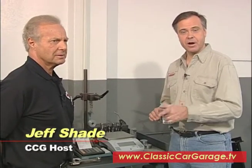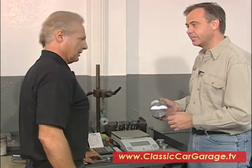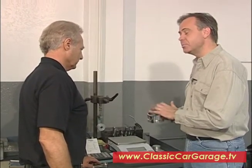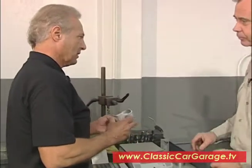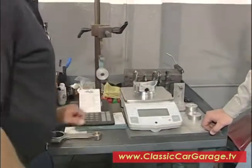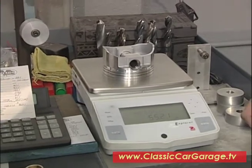Welcome back to Classic Car Garage. We're talking about engines here with Joe of Superior Automotive in Anaheim, California, and he's working on our Project 56 Chevy Sedan Delivery's 265 cubic inch engine. We've heard about balancing and blueprinting — let's talk a little bit about balancing. That has to do with the weight of each of the pistons and also the rods, right? These are brand new pistons, they come out of the box like this, but of course they all don't weigh the same to begin with. We weigh all eight pistons and take the lightest one in the whole bunch, and we'll match that weight to within a tenth of a gram. We have a gram scale here. The number will come up, and that's what we have to make each one to.